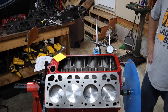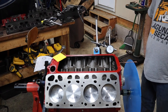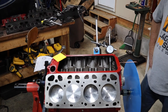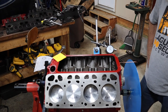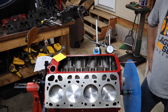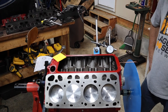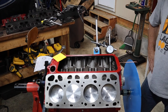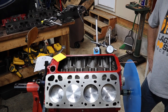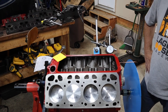At this point I've done it about 20 times on each valve. I feel pretty confident that we are 6 degrees advanced on the cam. So I'm going to take this all apart and change the timing set to correct for that, and then we'll measure it all again and see how it turned out.